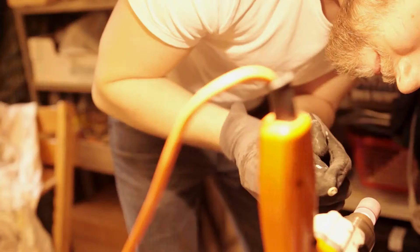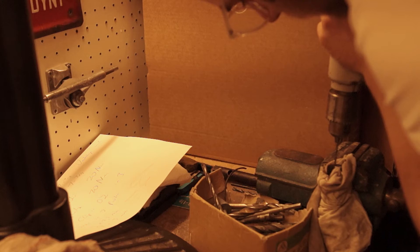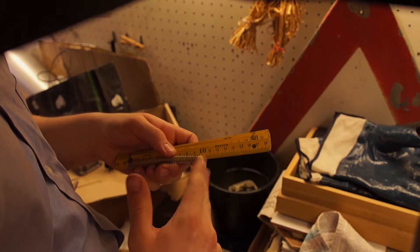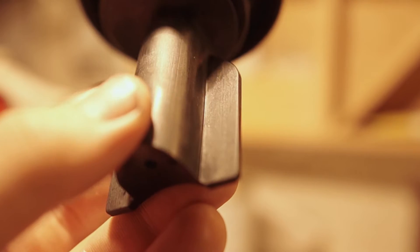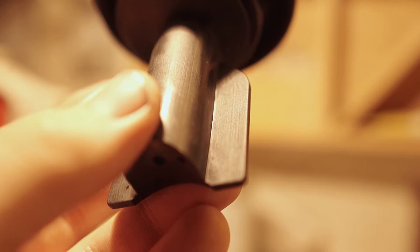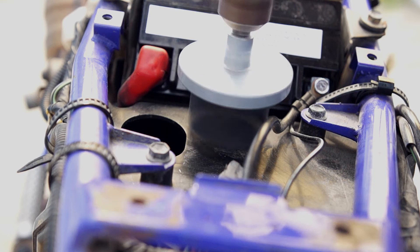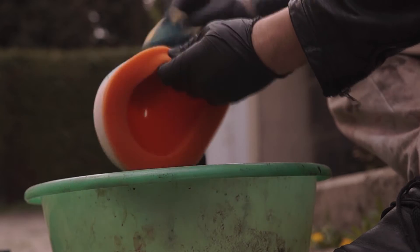I ground a new needle with a power drill and a nicely colored grinding head that's 25 millimeters long. I also drilled the slide for faster throttle response and shortened the new spring I bought. To round it all up I replaced most of the o-rings. You can see small scratches on the carb slide — this happens when you ride without a carb breather filter. I also cut a 51 millimeter hole in the airbox and replaced the air filter with a Twin Air aftermarket one.